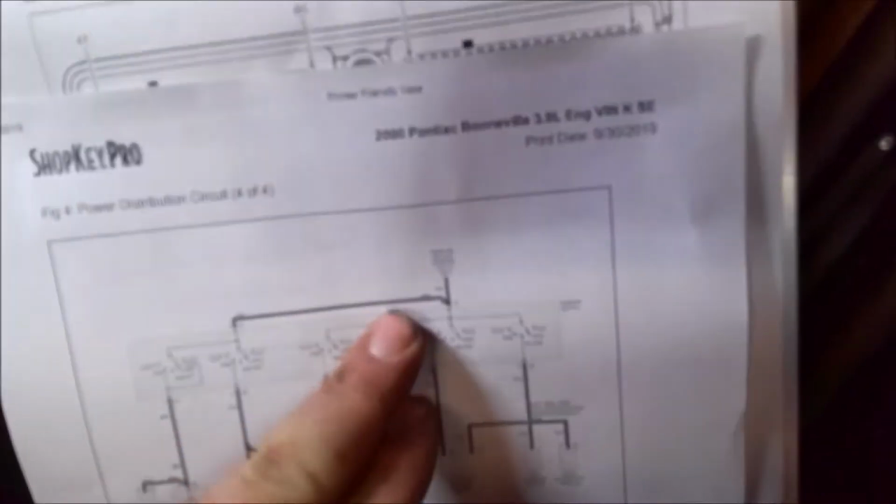If you look at the ignition switch diagram, it shows that you have the theft deterrent module and the dash integration module, which is basically the BCM, I think, on these cars, wired into that same wire. And anyway, there should be 12 volts coming out of here because you're going straight from a power source. Turn the key to different positions, and that's what sends a signal out. So I don't believe either one of these is pulling the signal or the voltage down. I believe it's the ignition switch itself.